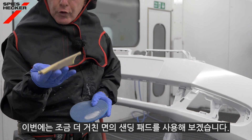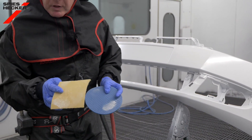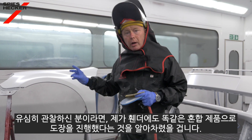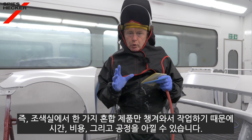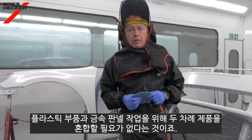I'll just take a different type of abrasive which might be a little bit more aggressive. Again, no issue with that. So you can rest assured this dries within five minutes. The observant amongst you will have also noticed that I applied the same mixture to the fender as well. This is going to save you time, money and effort because you only need to come into the cabin with one pot - you don't need two separate mixes for plastic and metal substrates.